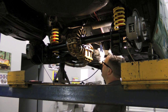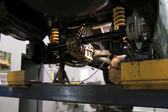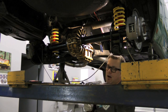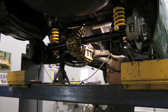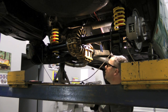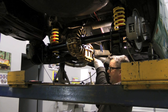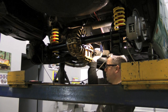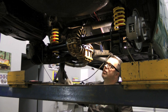A heavy articulated drive shaft steals even more horsepower. The drawback to a single-piece drive shaft though is that the rear end has very limited travel - on drop it's infinite, but on compression it's limited by how far up the vehicle can go because you're limited by the drive shaft hump where the rear seat would be. If a carbon fiber drive shaft hits that hard enough it will shatter; an aluminum one will come out of balance and give you a wicked vibration. It's not that one should be opposed to doing it - just recognize there is a limitation.